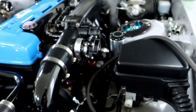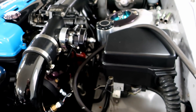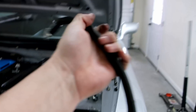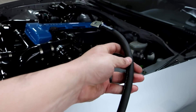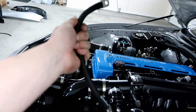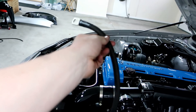I'll probably also make a ground strap from the block to the chassis — just to be safe. I've got extra wire and extra crimps, so might as well. Grounds aren't going to hurt anything if I go to a bigger ground — it's a nice peace of mind. I wish I could get a bigger bolt in there, but I can only use 10 millimeters from what I can find in the frame because I don't want to drill into the front frame rail. So I'm using an existing 10mm hole. I might grind down some of the metal just to get a better connection. But it does look hellaciously better — it's a giant hole there now. You've got to remember, this is all original paint in here, so I might have to scuff some of this and spray it with some paint just to make it look a little better.